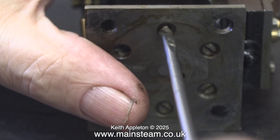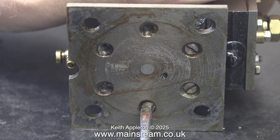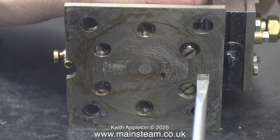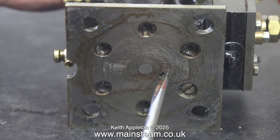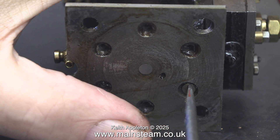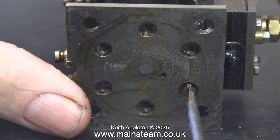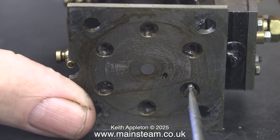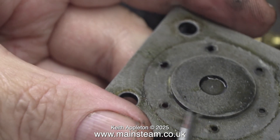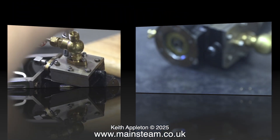The cylinder base plate is held to the cylinder using six small countersunk screws, and someone has drilled the countersinks far too big. This is a problem. If the countersunk holes are too big, the countersunk bolts bottom on the thread. There's only one way out of this: if the countersink is too deep, you have to drill out the ends of the threaded holes in the casting to allow the countersunk bolt to go further in. This is very bad practice, and under no circumstances must you use silicone sealant in an application like this — it's useless.